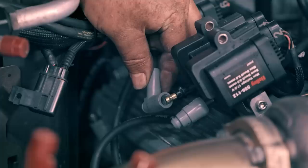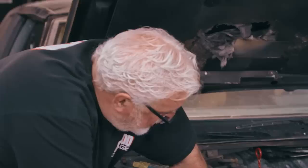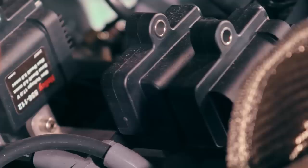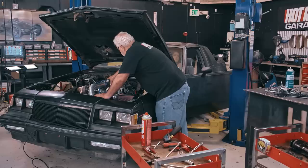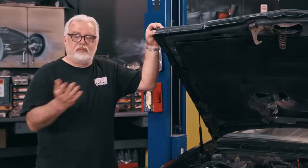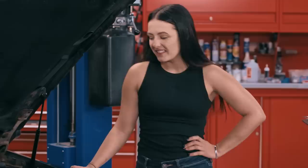We have a good spark there. All the coils seem to be putting out spark just like they're supposed to. Now I'm going to pull out a wire and see if that spark is getting to the other end. These things are pretty wet — I wonder if that injector's hung and just dumping fuel. The clip broke; maybe it just wasn't in all the way. It's running. It's running decent. I'm going to go out on a limb and say it's running better than it's ever run — and it's still running terrible. But it idles at least. Load it on the trailer, turn on the AC, and drive to the dyno.